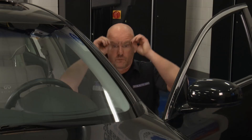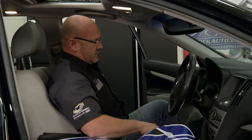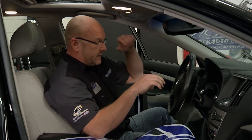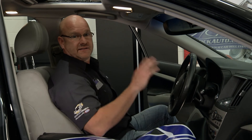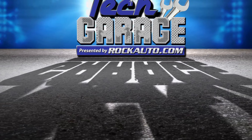There we go — that's the final of all four mounting bolts. We got the framework back with the vehicle so we can test drive the seat motors. If there was any play there we could damage those seat motors or actuators. All the fore and aft: no sounds, feels very fluid, it's parallel, both tracks are working right — we fixed that motor. To make sure all electronic connectors are properly reconnected, I'm going to test everything else: back, forward, smooth. Here's the hip hugger — great. Lower lumbar — great. This thing is in great shape. We spent a little time on this project but saved a ton of money — ended up being a $4.50 part from rockauto.com. That's at least a $796 ROI.